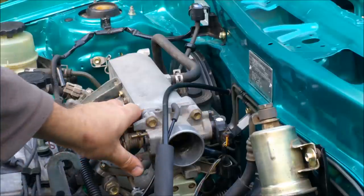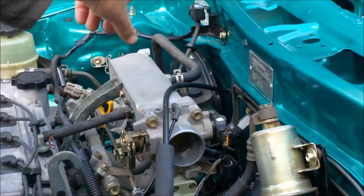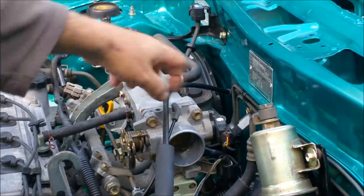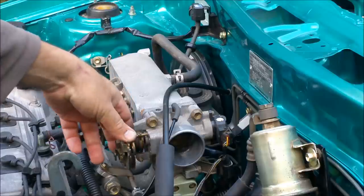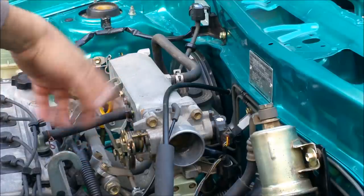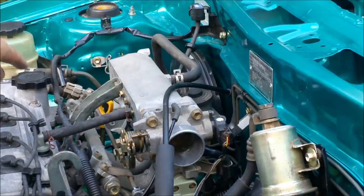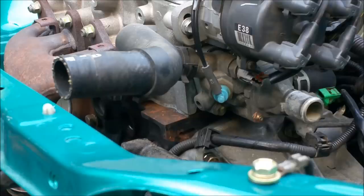When we're going flat out, or the throttle's wide open, the MAP sensor loses vacuum, it picks up that there's a loss of vacuum. The TPS is registering it's wide open. The computer's saying, rightio, this chap wants to go really, really quickly, or he's going up a hill fast or whatever. Let's open up the fuel injectors, give it more fuel, and adjust the timing accordingly. So it's not just about going fast, it's also about knowing what the engine is doing in terms of its temperature.